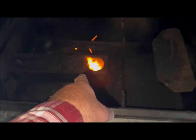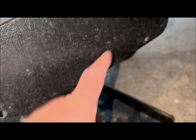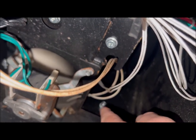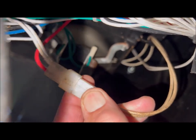There are four screws on top of the fire pot, and one screw inside to actually remove the hot rod from the fire pot. Then you come over here — there's a little plate down here. Unscrew four screws and this drops down from the bottom. Once you access it, you can see everything under there easily. There's only one plug you have to unplug, which is the one for the hot rod right there. Make sure you run the wires through the holes they come out of — there's one there and another one over there — because it keeps the wires out of the fan. You don't want wires getting in your fan; you'll tear your fan up.